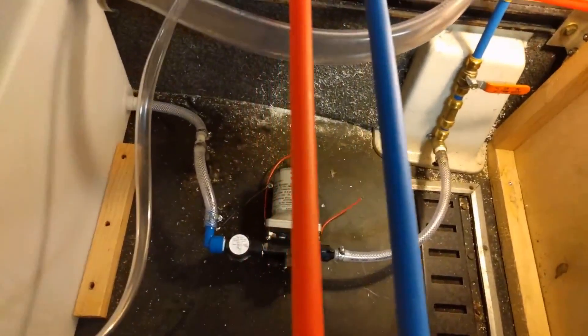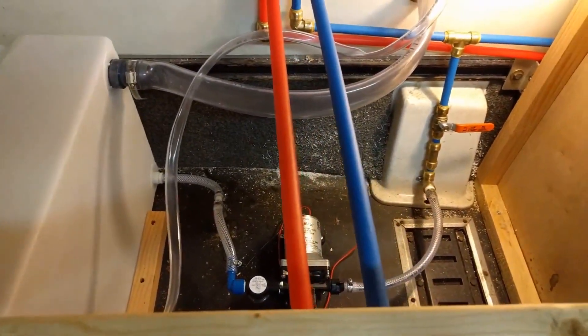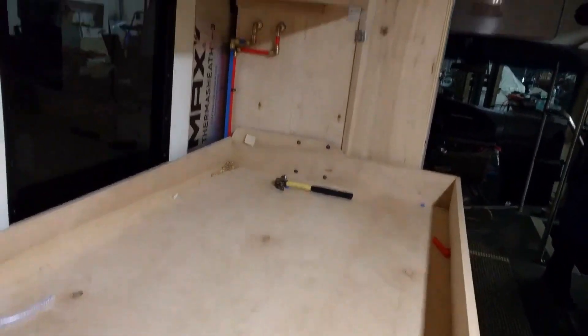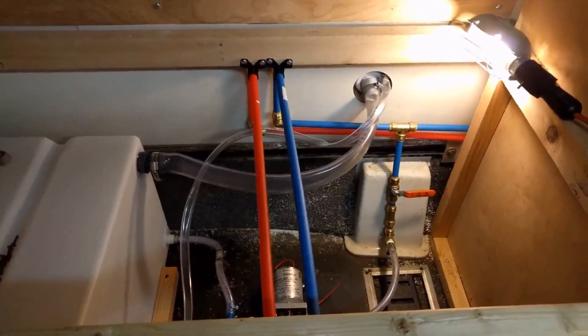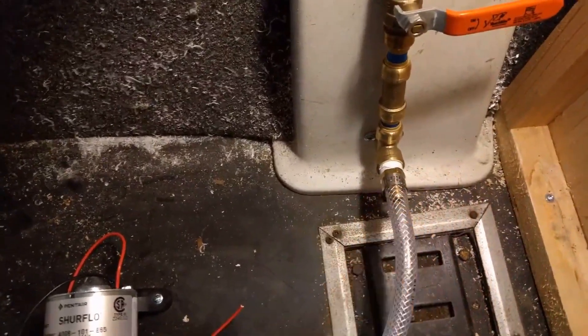I can turn off the water if I need to service this area with my little valve over there, and if I need to service the tank I just drain it from the outside valve. This end is pretty much done. After I hook on some bracketry to those lines underneath this bed, I think I'm going to be just about ready to start in on my electrical. All the plumbing is done — the plumbing to the sink is finished and that runs underneath this cabinet right behind me.